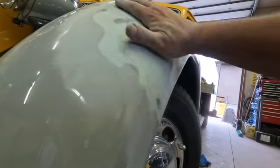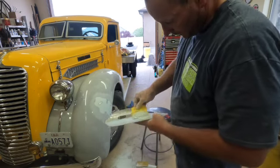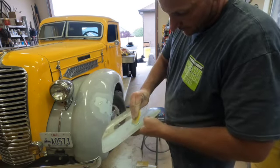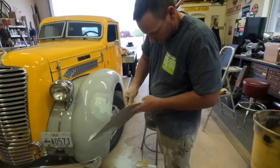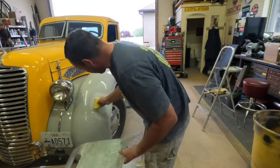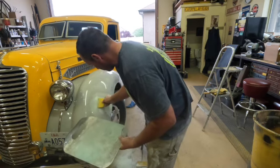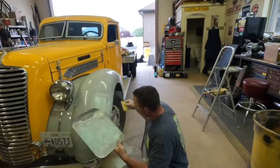I'm going to mix up a little bit more filler and get those low spots filled — put a little more in where I took too much off. Once the low spots are filled, I'll let it cure, sand it again, and then I've got some glaze to finish it off with to address any pinholes or small issues. When you mix this putty you've got to work fast but get it all the same color so you know it's mixed well. Put it on thin — it's always easier to sand more off.